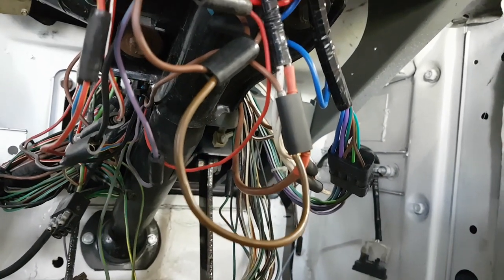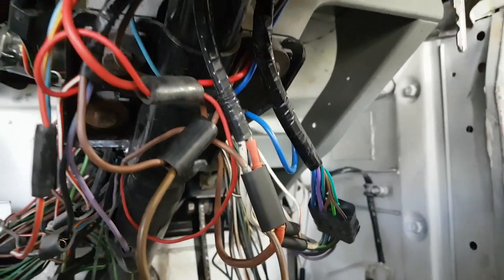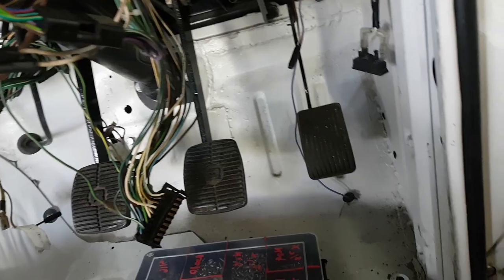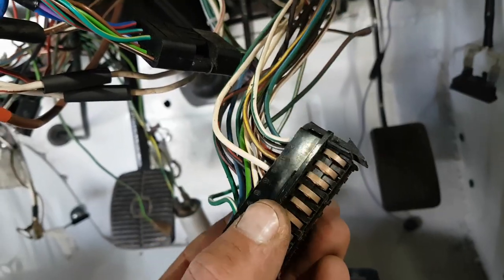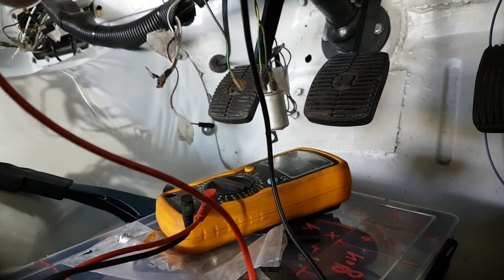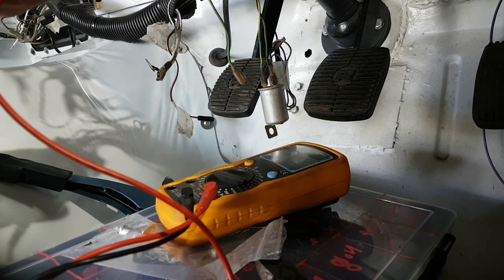Next is the white circuit. So the white circuit is unfused but ignition controlled. So top of those two fuses over there is both white. So I am anticipating that when I put the ignition into the on position, I should get voltage at those white sections. In fact, there's a white one on the back. This is the plug that goes onto the back of the instrument console up here. So let me... Am I getting voltage here? I am getting...